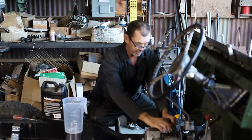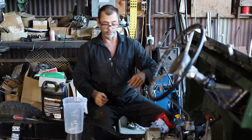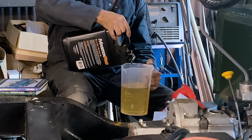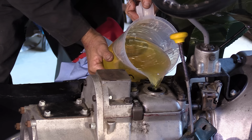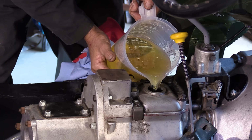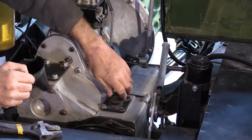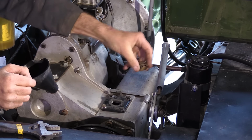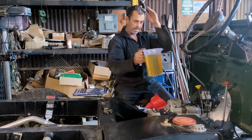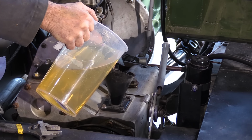Now moving to our transmission side of things, both of our series 1, 2 and 3 manuals say 1.5 litres for the gearbox. Got my special measuring jug. Another bonus about doing this too is that I find out if there's any nasty leaks while I can still do something about it. Okay, and then for the transfer box, we'll be asking for a little more, 2.5 litres. I think we're talking metric. Punishable offence around these parts.